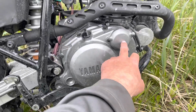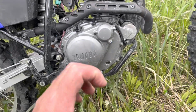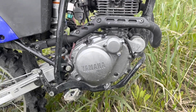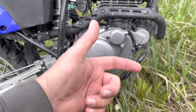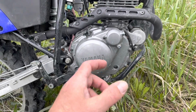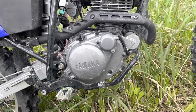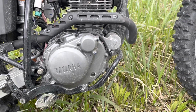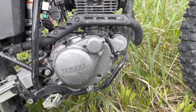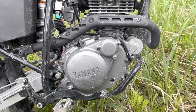This actually has a proper oil filter. It's a metal type, very fine mesh. Says you can clean it, but it's got a steel end. It's like a barrel with a steel end on one side and a hole. I don't know really how well you'd be able to clean that. Anyway, I just bought 2 of them when I picked the bike up, and I'll just throw a new one in. They're not that expensive.